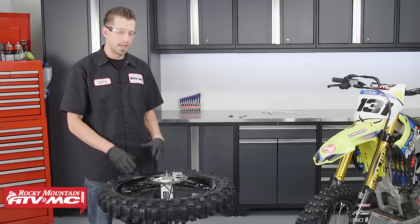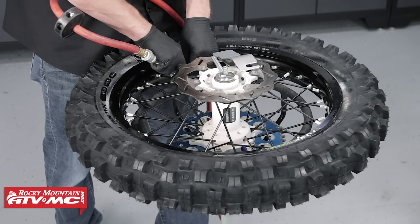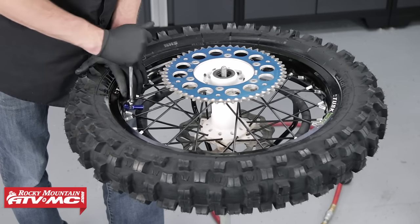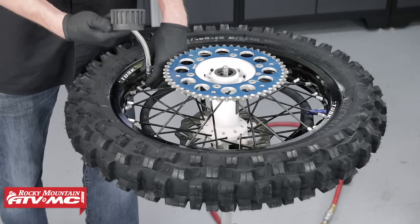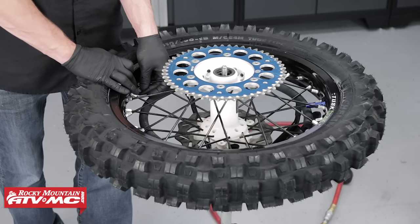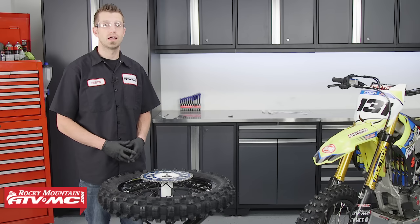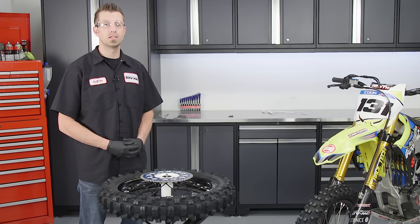Once we get the bead tool removed, we can now inflate the tire and seat the bead. When filling your tire and seating the bead, make sure to check the sidewall of your tire and reference the max pressure — do not exceed it. Once the tire is inflated, inspect the bead to make sure you've got a nice uniform bead on both sides. If everything looks good, go ahead and set your rim lock. Once the rim lock is nice and snugged down, we can then set our tire pressure to your desired PSI, and install the valve stem cap. Then bring the valve stem nut up to the valve stem cap and just snug it on. And that's it — that's really all there is to changing out a tire on a dirt bike. Hopefully the process we've shown you today helps clear up some confusion and makes changing your tires a lot easier in the future. If you have any questions, feel free to leave a comment below and we'll get an answer back to you. I'm Dustin with Rocky Mountain — thanks for watching and keep the wrenches turning.